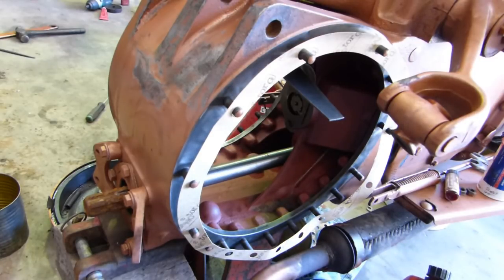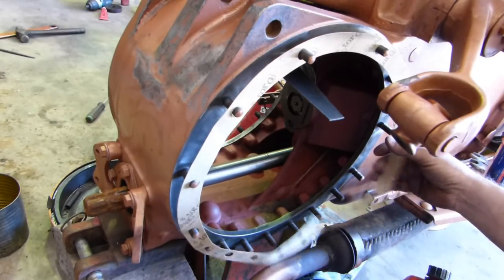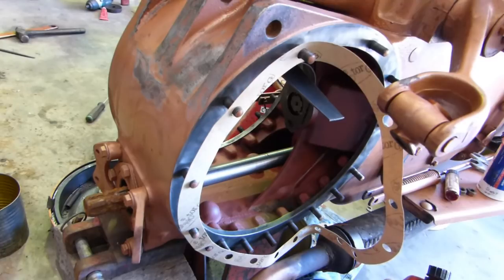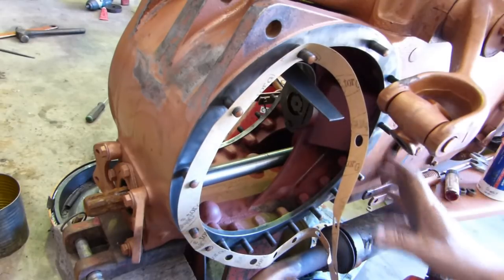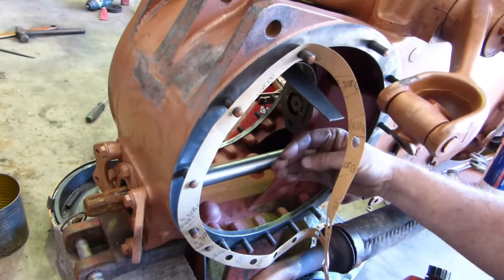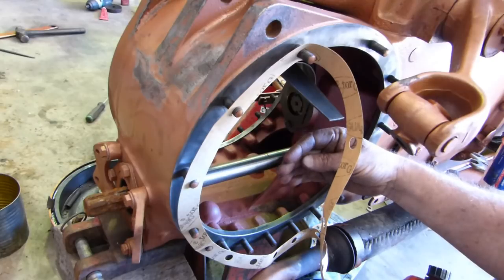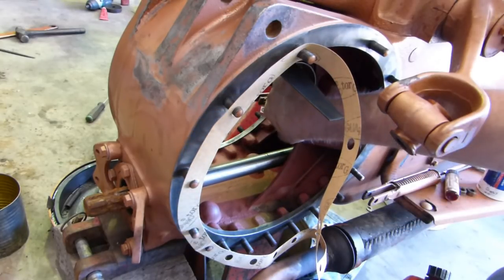Now let's have a discussion about gasket goo. When you look at gasket goo, you have to look at what you're expecting from it. If you put Loctite 515 around here and put it on, not a problem - you could do that. But keep in mind that the housing here, with your diff bearing in, if you take these gaskets out, you've tightened up your diff that much. And so by having no gasket this side and a gasket the other side, you push your crown wheel away and end up with too much backlash between your crown wheel and pinion.